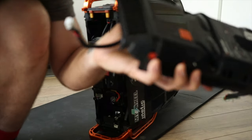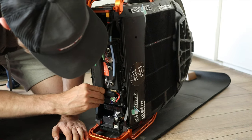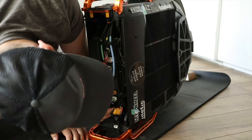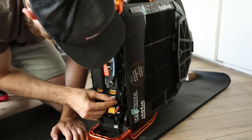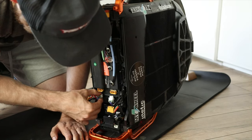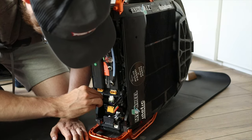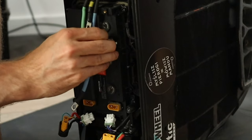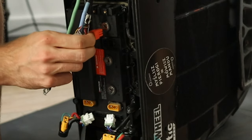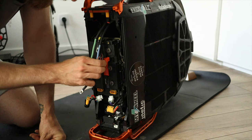My display looks nice, but I've heard of a case where a display was fogging up from the inside. The nice thing about unplugging the battery connectors is that there is no spark once you reconnect them — that's clever engineering. Now I'll remove the communication wire between the battery and the board on both sides. Those plugs just seem to be a bit too easy to pull out of the socket. There is a hook which should keep them in place, but it doesn't seem to work all that well. During normal riding I don't think that would be a problem, but with very strong vibration maybe they could get loose. The same thing applies to the hall sensor connectors — the redundant ones. I just hope it won't become a future problem.